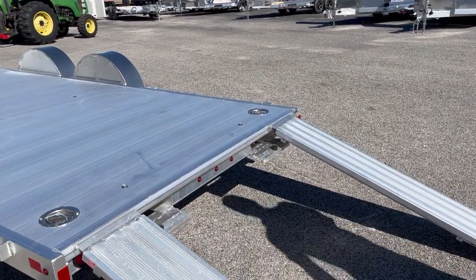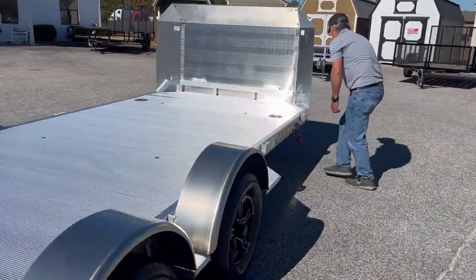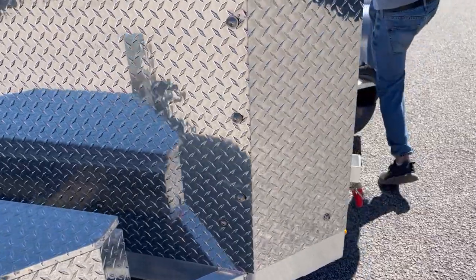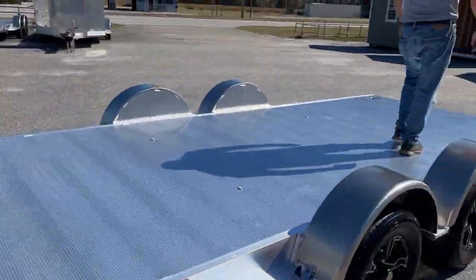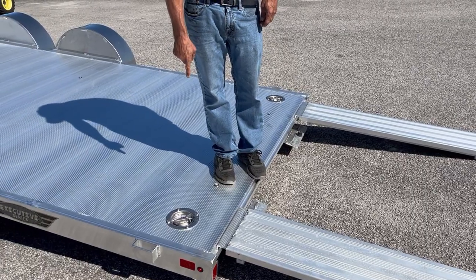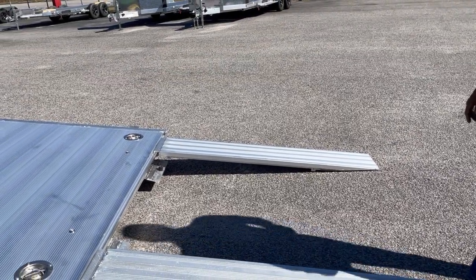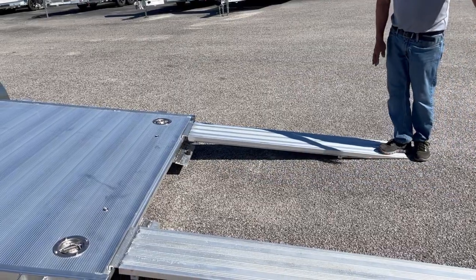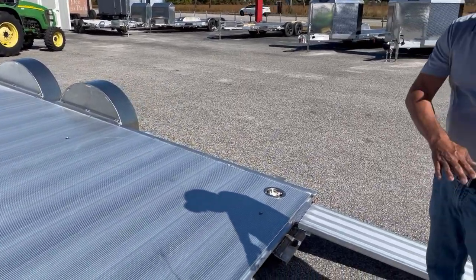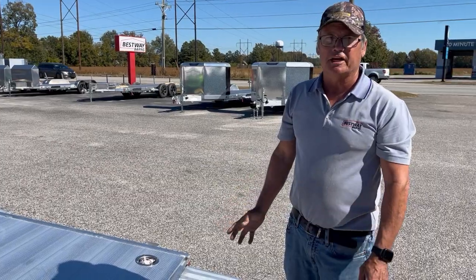If we just set these ramps up — this is a tilt-deck trailer. Normally the ramp is going to take care of this. The trailer has a bumper under the bottom that stops it, and the approach angle has been lowered by the ramps. The tires hit the ramps, which lifts the air dam and gets the car's angle straight with the trailer to load the car onto the trailer. You don't have any hump to go over, so even a car this low to the ground is still going to load without damaging the vehicle.